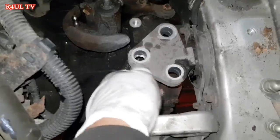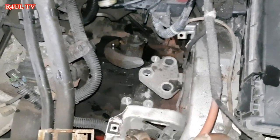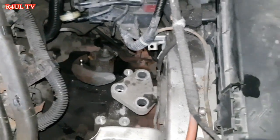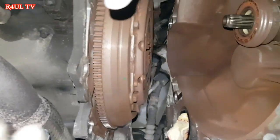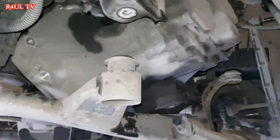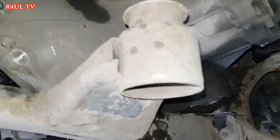Right guys, the mounting is totally off, which is here, as you can see. It's supported by the jack. I've got the jack underneath it and a block underneath it, so that should hold it. What we're doing now is we're gonna send it up and attack the bottom, take the gearbox out. Okay guys, as you can see here, we've separated the gearbox. We didn't take the gearbox out. There it is, resting on the subframe. That's the way I do it.